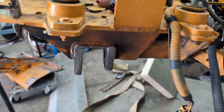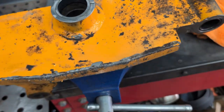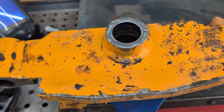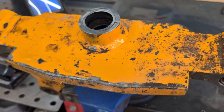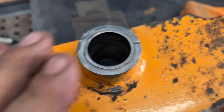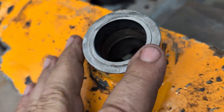In the last couple videos I showed how I beefed up underneath there, plated it with half-inch plate. This here is the axle that pivots left and right. I got this back from the machine shop, and when I put it in my truck and looked at it again, I made a U-turn and went back. The owner is 87 years old and the shop is getting old. They had to cut this down for me — I gave them dimensions to machine it because we thickened it up, and when you do that you have to reduce the center here.